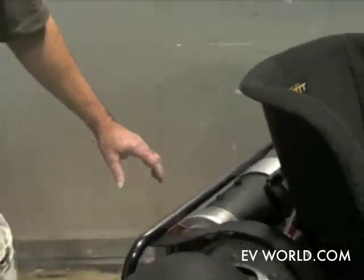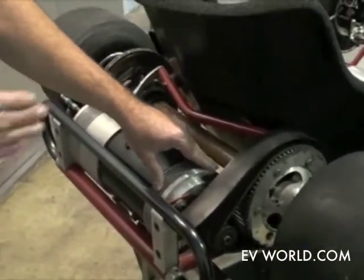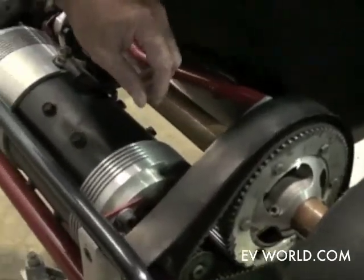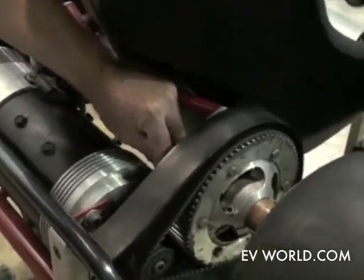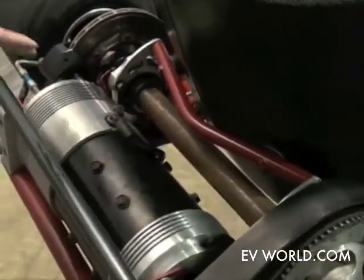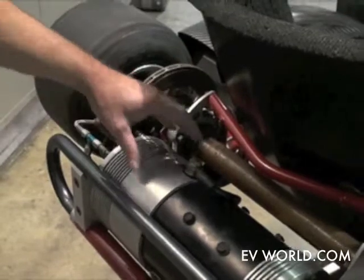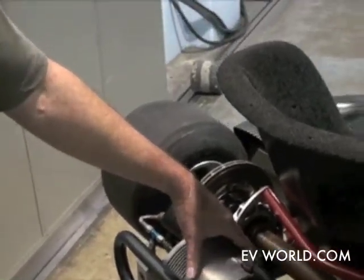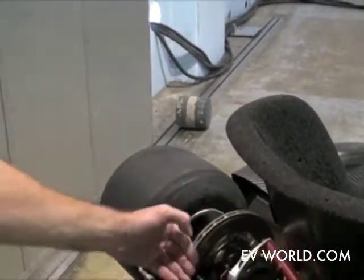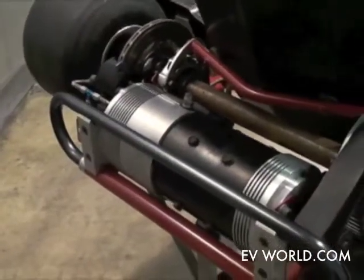We built this custom casing to carry it. Most motors are mounted to a faceplate, and they mount on one side. You have to have probably a 3/8 inch steel mount. I wanted to run this thin axle carrier into the motor mount metal, so we had to come up with a way to take the weight of the motor and carry it over to the other side of the frame. So we built this structural can. Air comes in this side, hits the back and gets sucked through by the fan, and then exits out this way, so it helps with cooling also.